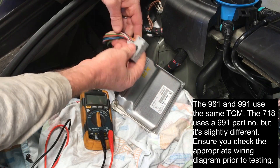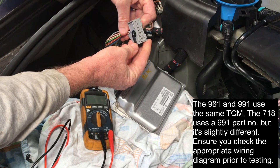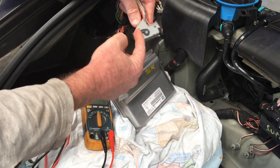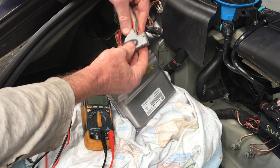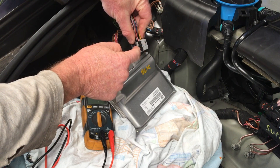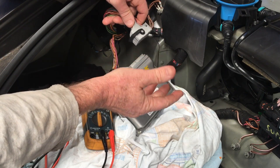It's the grey one that we're going to look at. I've removed all of the insulation tape from it just so I can separate those wires out a little bit more easily. What we're going to do is remove this big plug off the outside, separate the two individual plugs inside, and then plug these in separately prior to getting the car going.